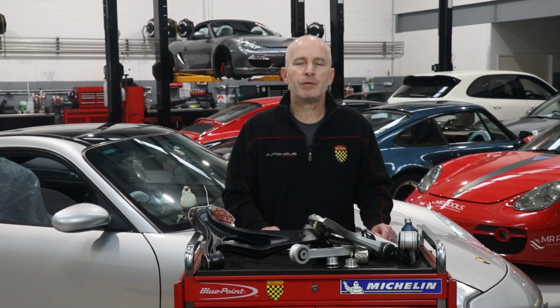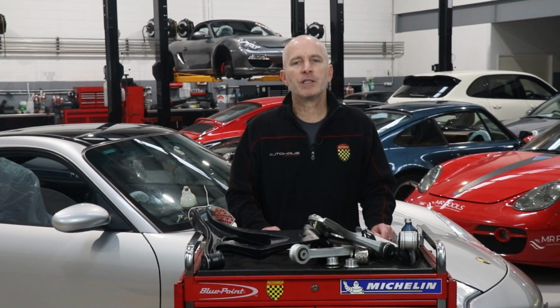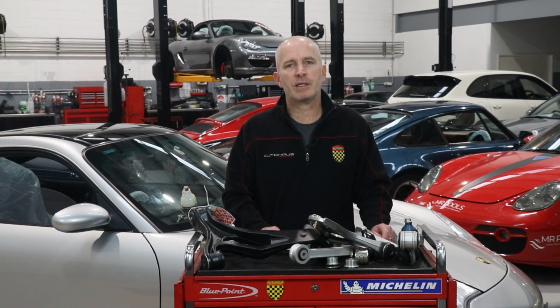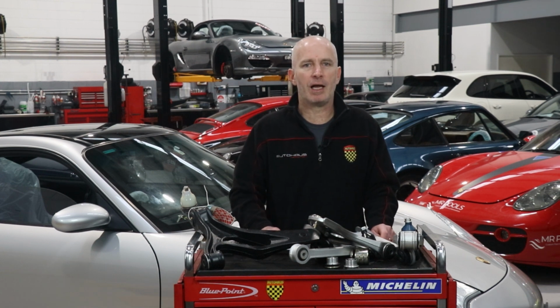By the time the 993 came along, the 911 was a far more sophisticated vehicle than it had been in previous generations, and this was most clearly apparent in the car's rear suspension design. Where the 964 suspension design had replaced torsion bars with coil springs, the 993 went much further and adopted a multi-arm rear suspension design with a plethora of adjustments aimed at ensuring that the car's suspension kept the wheels pointed in the correct direction at all times.